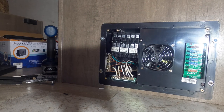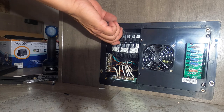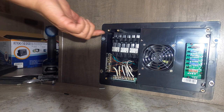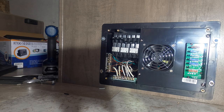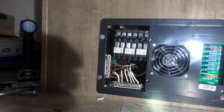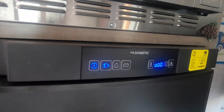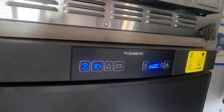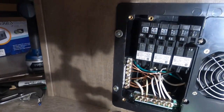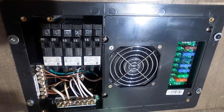I've plugged into shore power, 30-amp. Throwing the main breaker — number two is the heater and air conditioner, number three is the water heater, four is the microwave — the microwave came on, that's a good sign. Next is the refrigerator — let's turn on the fridge. I don't see an alert; that looks good. And the last one: breaker six is the converter, which charges the battery. The fan's starting up — that's good news. It means the converter's working.